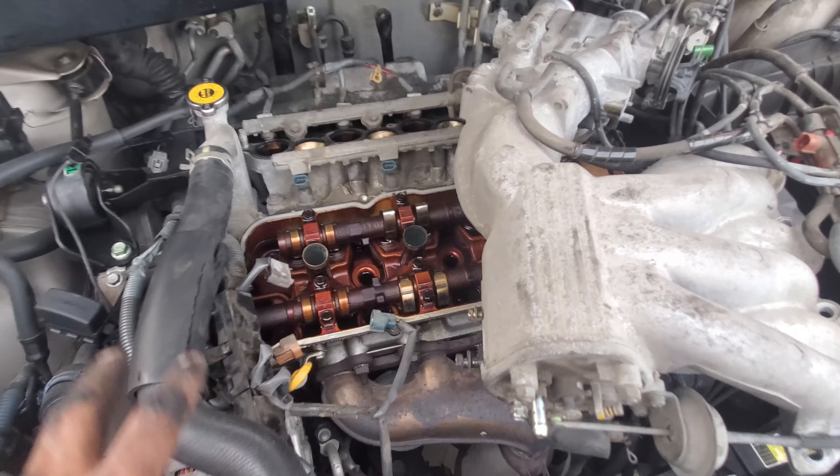There it is — there's the old seal. So now to put the new ones on, these go in like this, straighten like that. We're gonna put three of them. The seal is pretty self-explanatory — it goes on the edge, just like this. Fresh seal installed, new spark plug grommets in and it's ready to go. As you can see, the old one is all hard, not flexible.